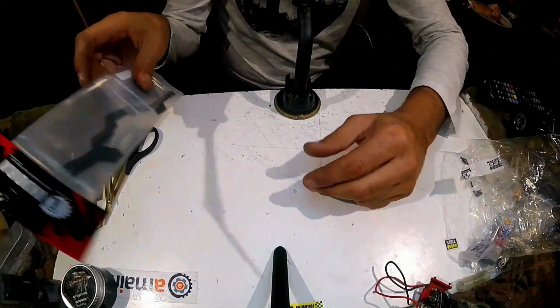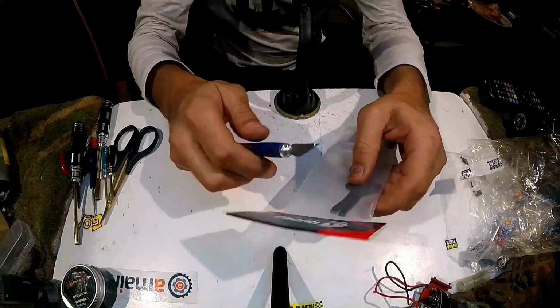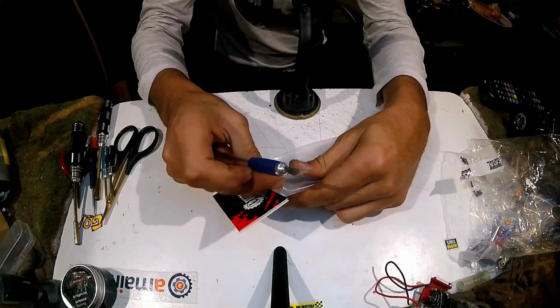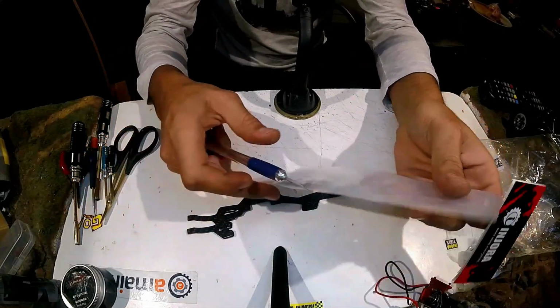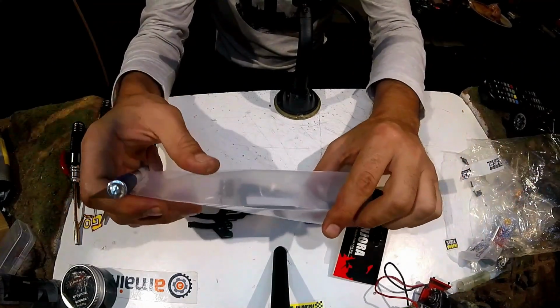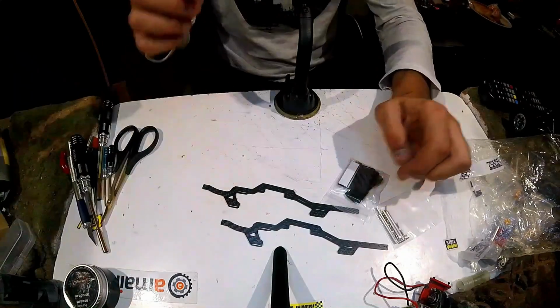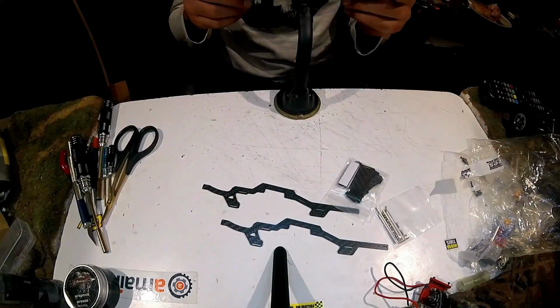Part 3, Chassis and Suspension Assembly. Let's start this build by the assembly of the chassis. This chassis, with its 6-degree angled frame, significantly improves the crawler's handling by keeping the weight low, which is essential when navigating steep inclines or uneven surfaces. I have used it on several of my builds and find it to be really solid and allows the car to sit very low.